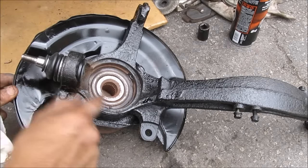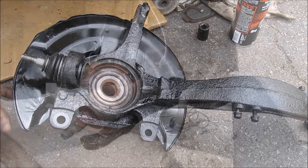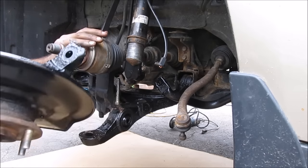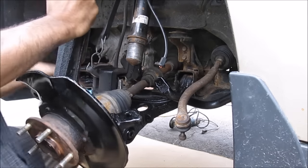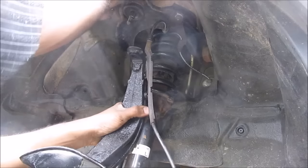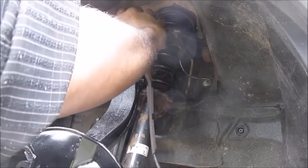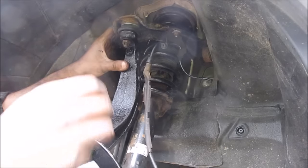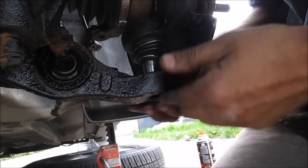Here I've got my knuckle with the ball joint pressed in — it's all cleaned up and ready to go. Make sure there's no gunk inside of here because that can interfere with your ABS sensor. Next we're going to install the knuckle onto the car. We're going to thread in first the lower ball joint and then the axle. Line up the axle, take the upper control arm and align the upper ball joint into the knuckle, and replace the castle nut. Next I'm going to replace the lower ball joint into the steering knuckle.